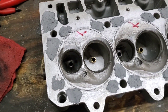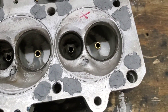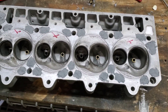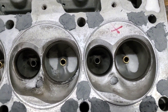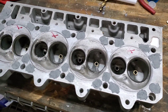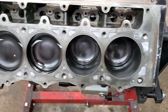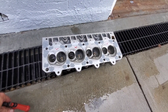All the holes are filled with epoxy. It takes a little while for this stuff to set up — I'll just leave it overnight, come back and chip the biggest part of it off. I'm going to send these heads to TKM and get them to pull those top fuel hoops out and resurface them. A lot of times with aluminum heads, guys will dry deck all these water ports just by welding up the holes. I could have done that, but these heads are about junk anyway and I didn't want to put any more heat into them. I've had a ton of issues out of these Dart Pro 1 LS3 heads, so I went ahead and put epoxy in them to keep the heat down and keep them from warping.